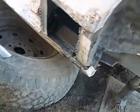So a little bit more touch-up welding, and then I'm going to finish her off and get the outer panel welded on. Then I got to get down in the lower rocker. Get these pieces fabbed up.